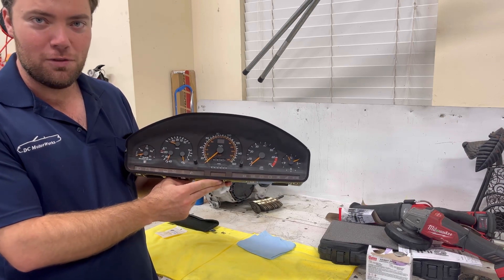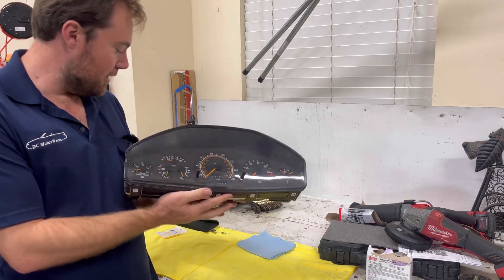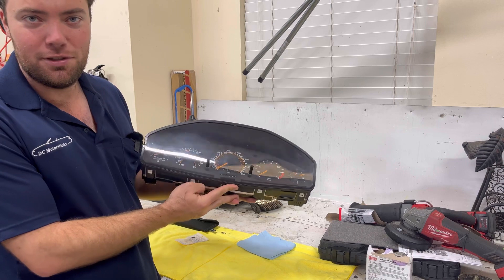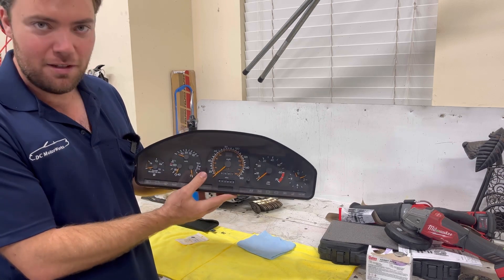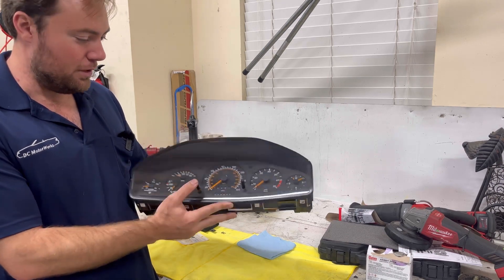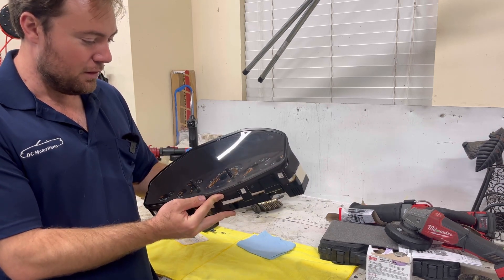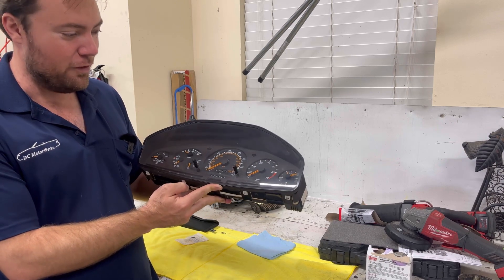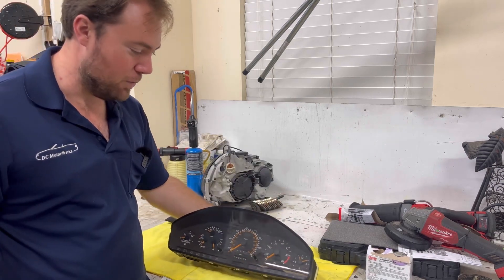Anything here with the mechanical odometer — see if y'all can guess what a very common problem on these is — and it is the odometer gears. We've got a pair of them here. A lot of times these are plastic gears and they do fail with age, but what usually happens is someone will reset their trip meter while the car is moving, which it's not designed to do, and that will break the gears. I'm sure they're off by just a little bit because for at least some time the odometer probably wasn't working because of these gears.